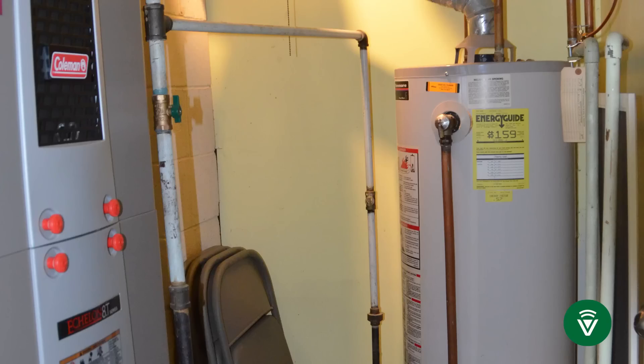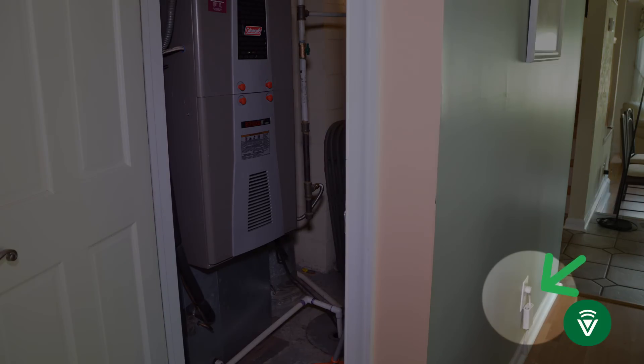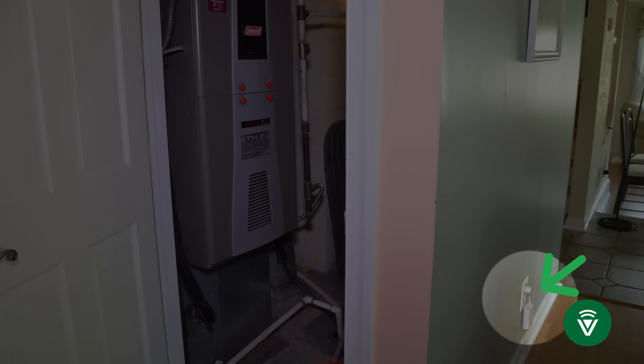So what do you do if you're having that issue? It's really simple — add more devices. Try to think logically about where you're having that problem, what's causing it, and then put another device nearby. Like this Z-Wave light bulb here in this closet — it's surrounded by metal, it's surrounded by ductwork. So what did I do? I put one right here on the wall, right opposite it, and it's close enough that this appliance module can act as a repeater.